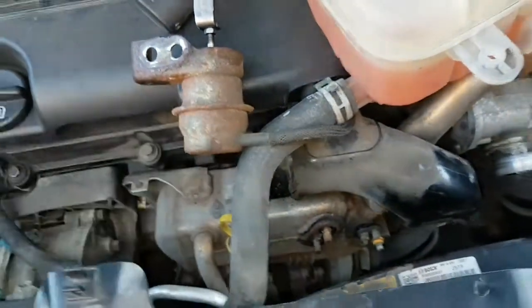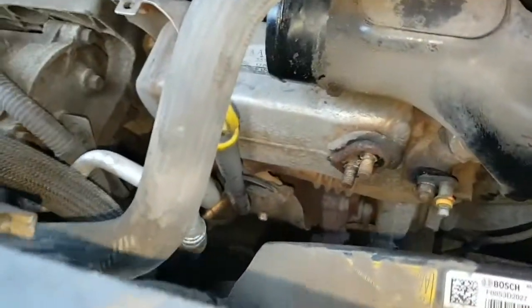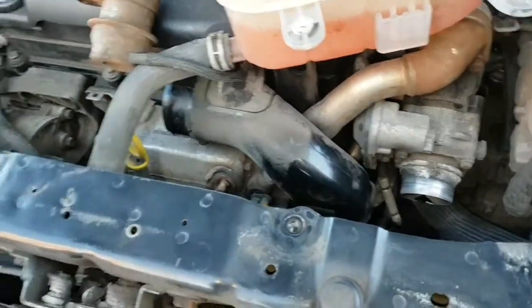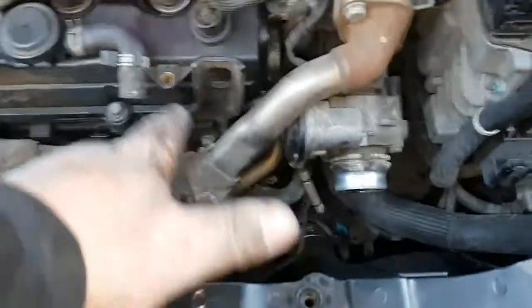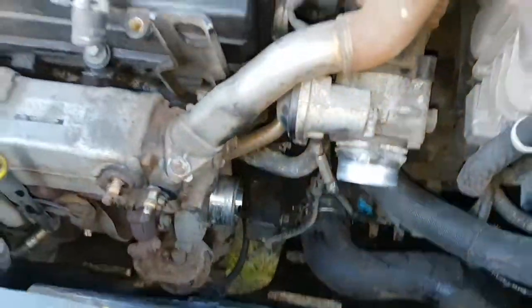I've had to take this off and this off as well — it's just two bolts, that bar goes on there. You've got a washer, two bolts, and that little rod that goes through the hole to hold it on, so you take that off. There are two bolts holding the fan — one just underneath the big pipe. Your fan just pops up. You have to take this off so your fan will lift up through the hole. I'll also take the big black pipe off here — it connects to the bottom, it's a straight screwdriver, and it bolts into the top here.